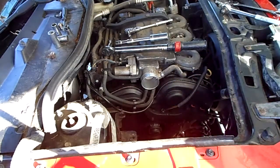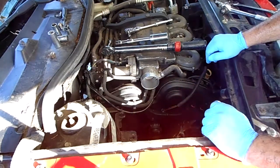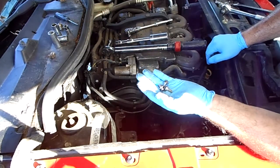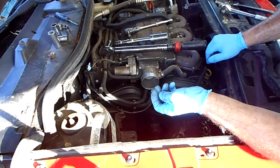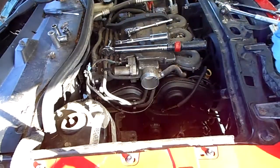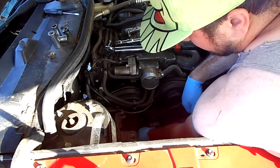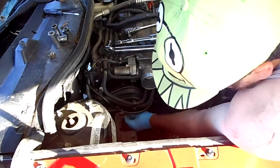I made them aware. So there are four E10 bolts that we'll be putting back. These bolts, since they're similar to an M8, I'm only going to use probably 8 foot pounds of torque, or around 100 inch pounds of torque. That's just a guesstimate — I didn't have anything online that was easily relatable. But that seems like the right torque setting because of the size of the bolts.